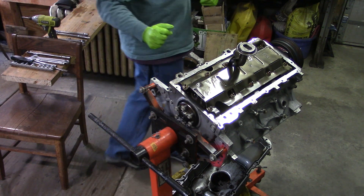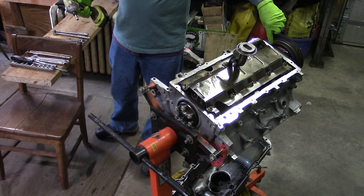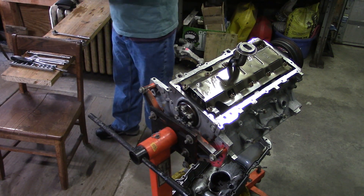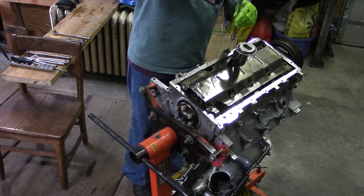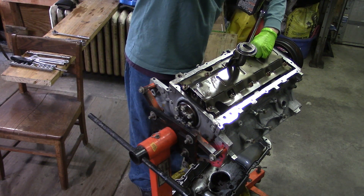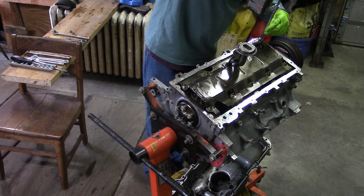I figured out a way to get you to see the action here. I've already loosened up all these bolts that I've taken out — the bolt that bolts in the oil pickup too. These all have 13mm heads. I'm just going to wind them all off here, all these nuts. These two nuts hold the oil pickup on. The rest just hold the windage tray.